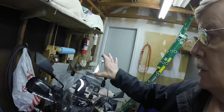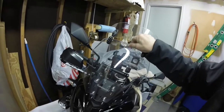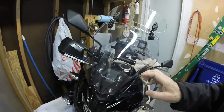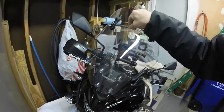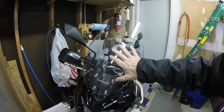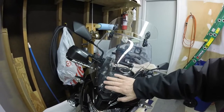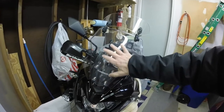The goal is to raise the windshield up a little higher than it is now and eliminate this extender. Where there's flex, there's stress. Where there's stress, there's fatigue. And where there's fatigue, there's going to be breakage — something here is going to give eventually. So the goal is to get rid of this, raise the windshield up, give it some test mileage, and keep the bike looking kind of stock.